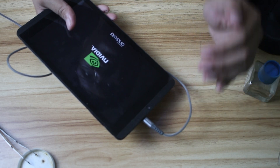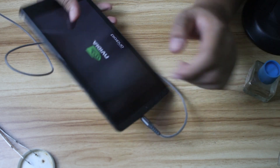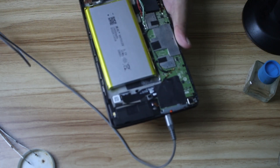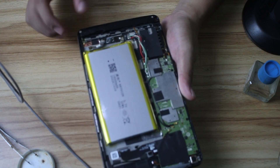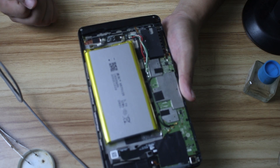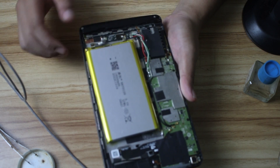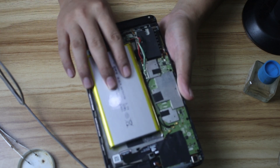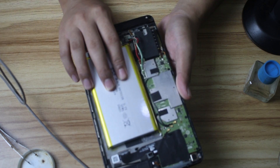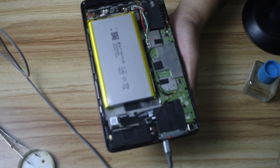There's a certain threshold — if the voltage drops below it, your device won't turn on. Technicians would sometimes jump a wire and run DC power through it for a few minutes just to give the battery enough charge to turn on. However, this battery was reading at 3.8 volts, so it shouldn't be too discharged. If you have any idea what happened, let me know in the comments.